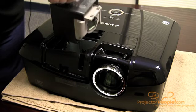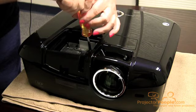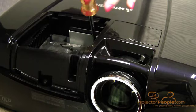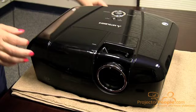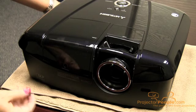Take your new lamp and seat it right into the housing section, pressing it down and making sure it's in the right spot. There are little guides or holes that you can line up. Then screw everything back down, put the cover back on, and put the little screw — hopefully the one you didn't lose — back into place, along with the little cover.